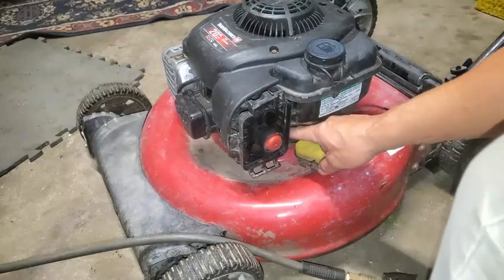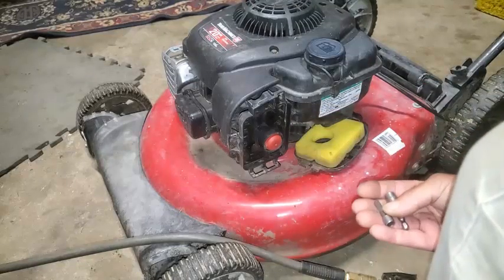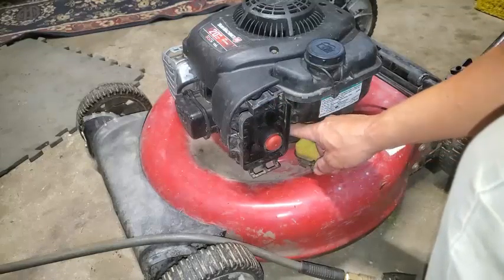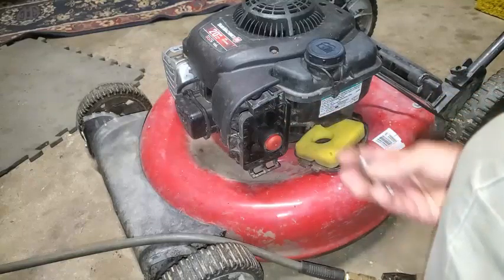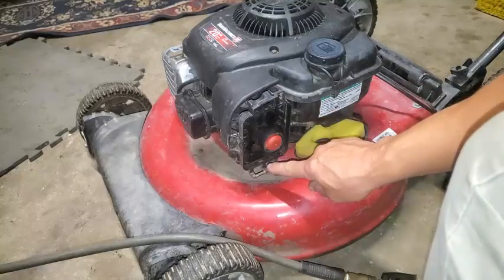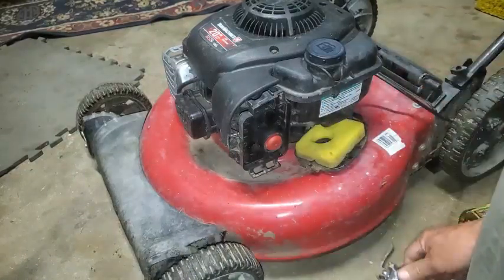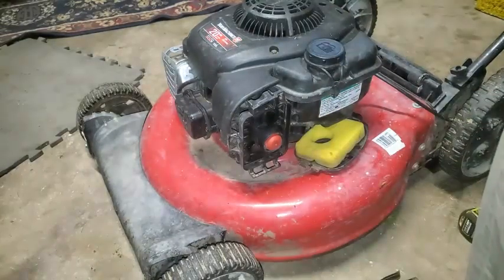Since I'm going to have this disconnected, I'll probably go ahead and drain some of the fuel out and take a sample. Because if there is any water in here — which is really a possibility and most likely what's going on here — we'll take this fuel line off, take the carburetor off, and then drain some of that fuel out to see if there is water. It'll be collected at the bottom of the gas tank and at the very bottom of the carburetor float bowl. I'll also be using a big flathead screwdriver to pry the bottom of the float bowl off.